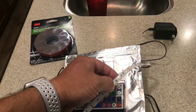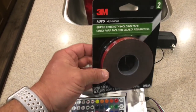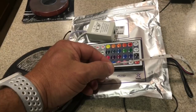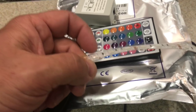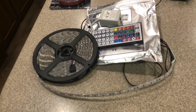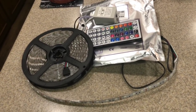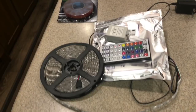The lights have some sticky backing, but it's not strong enough for me, so I went to O'Reilly's and bought double-sided automotive tape for 14 bucks — it's very strong and will hold these lights with no problem. Also, if you decide to get LED lights, look for the style that has a plastic dome coating over the LEDs. Some look almost like paper with a sprayed waterproof coating, and that does not last — the plastic dome style will last a whole lot longer.